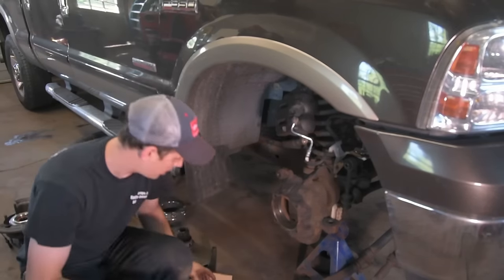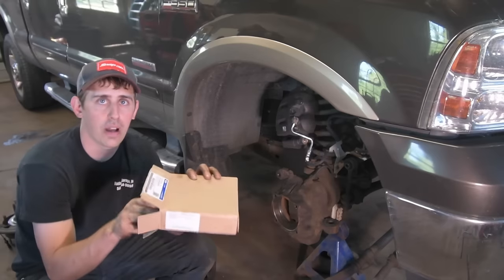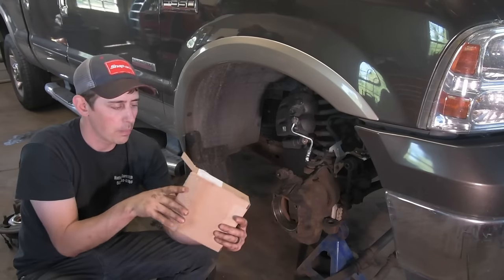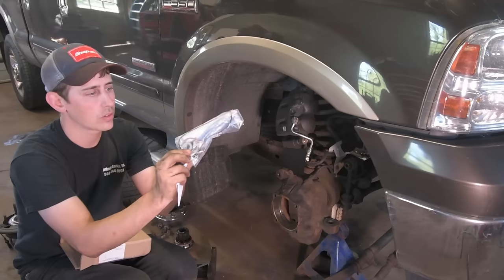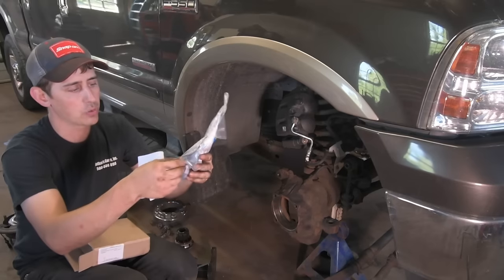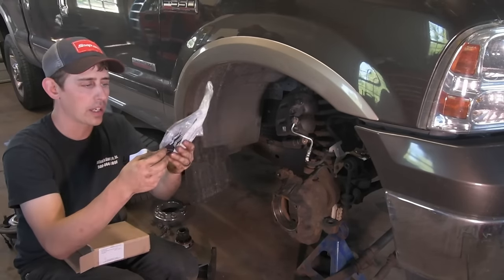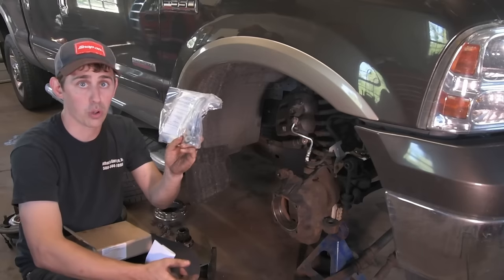The other seal you need to replace, very important, especially if you have vacuum 4x4, is this kit right here. So I highly suggest getting this from Ford. I'll put a link in the description to as many of these parts as I possibly can. But this kit comes with a new C-clip, the snap ring, I mean, that holds the axle into the wheel bearing. Comes with a new rubber O-ring for the wheel bearing itself, where that seals into the housing. Comes with new nuts that hold the wheel bearing on, and it comes with the stuff you need to seal up the 4x4 hub and three new bolts for the 4x4 hub.